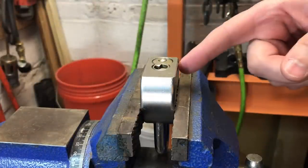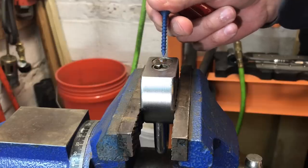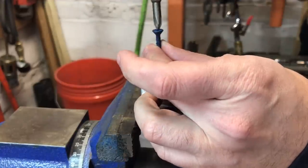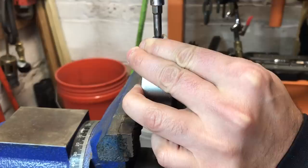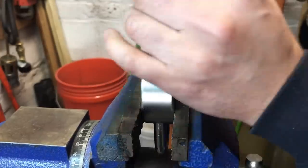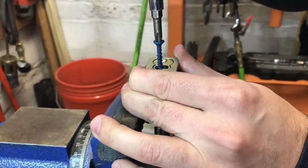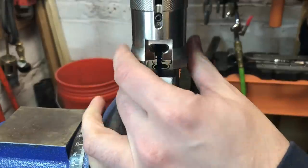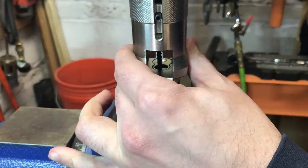Okay, we're out in the garage. I've got the lock in the vise and I'm going to put this screw in. I'm going to try doing it by hand because I've had some bad luck in the past trying to put these in with an impact driver because they will snap off. It's not easy to put in but I am able to get it in pretty well. I think that should probably be enough — I don't want to risk breaking it off. So let's get our puller. I'm going to put it right around that screw and then hand tighten it to the point where it engages with that screw head.